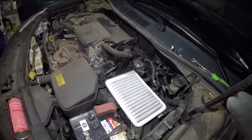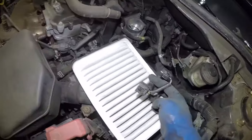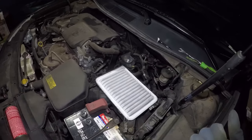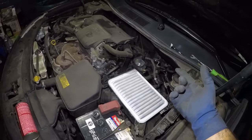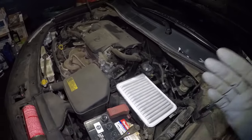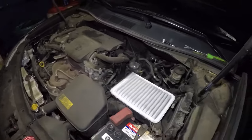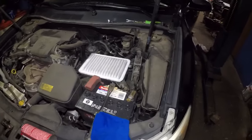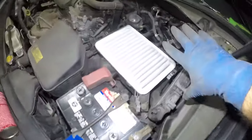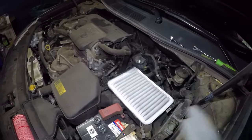If you don't have a scan tool and you're doing it this way with the two connectors disconnected, you're gonna have a check engine light. You're gonna have codes for the evap sensor, codes for a mass airflow sensor or air temperature sensor — it's all because it's disconnected. But what you can do — I have a scan tool so I'm fine. You could take that and just put it to the side and reconnect it. I make my life easy — more space and I don't mess anything up.